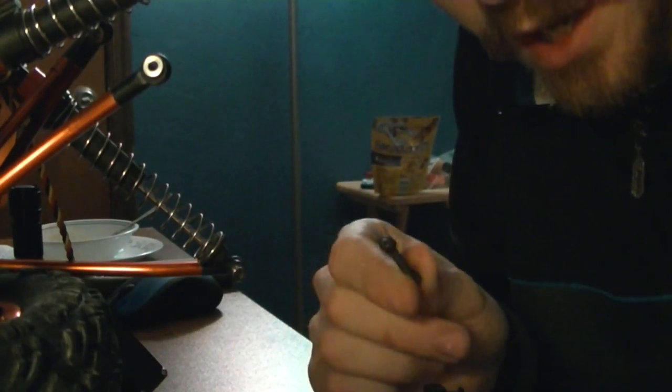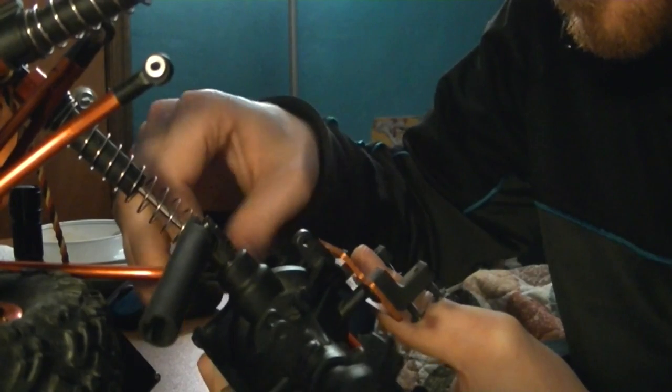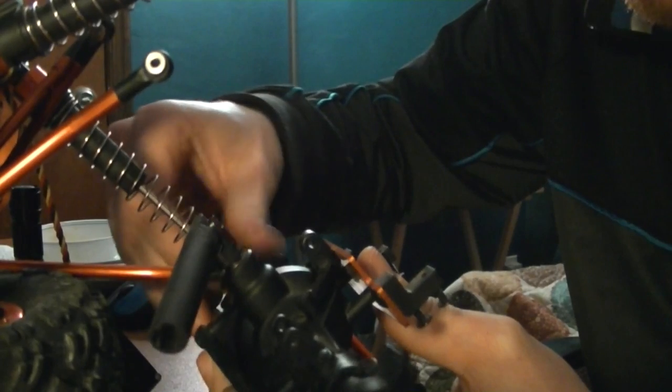And now to put it all back together, you need these long screws with the Nylock bolt or nuts on them. You're going to grab a lower A-arm and your shock tower. And you're going to line it up in between those two knobs right there. Once you're lined up, you're going to take that bolt and run it completely through. Which requires being turned because it's all threaded.